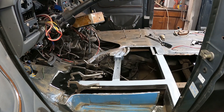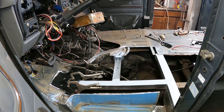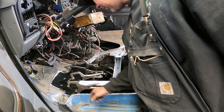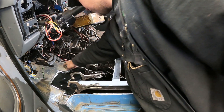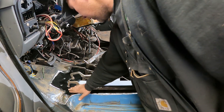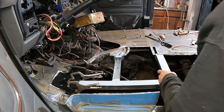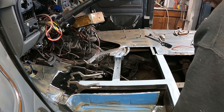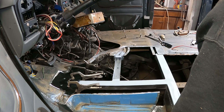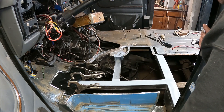I'm one step away from getting the pan welded in. I had bought this upper floor pan that went all the way up to the firewall — obviously I didn't need all of it, so I just cut the bottom piece out that I needed. I've got spot welds drilled out to plug weld into the brace underneath, just got it temporary clamped in place. I'm going to skip weld it around the edges with about a half-inch overlap onto the existing floor. I'll seam seal the bottom edges. I needed to get this in because the big floor pan will go over the top of this and weld into that. I've put primer on the tops of these bare metal pieces. I still need to bend up the top and weld onto that brace where I cut it off. Then I just got to drill out the plug weld holes in the big pan and I'll be ready to clamp on and get the whole thing welded up.